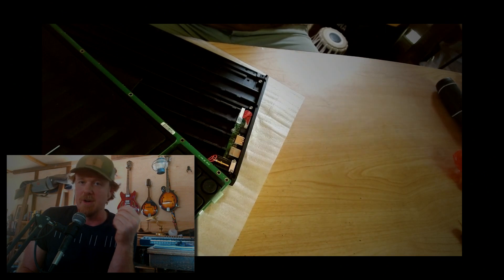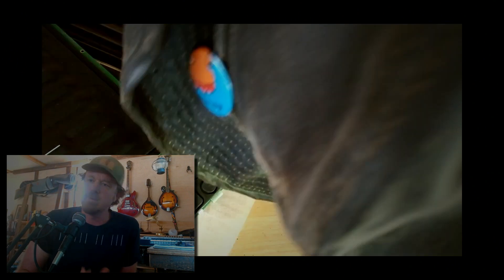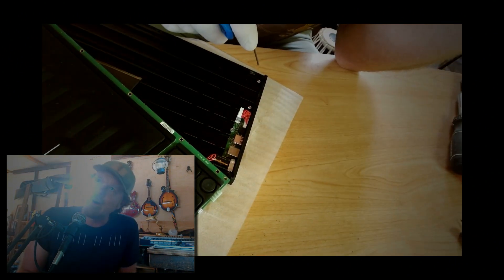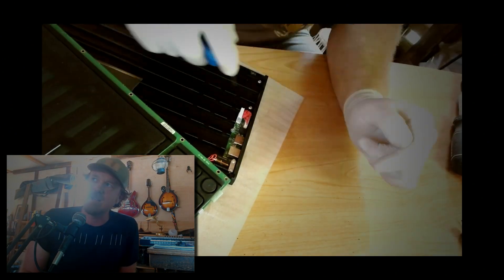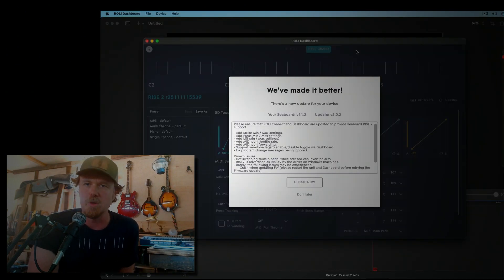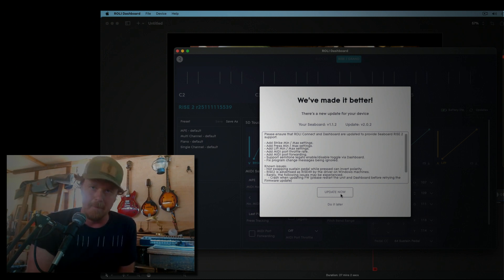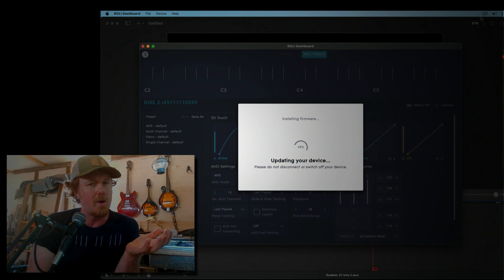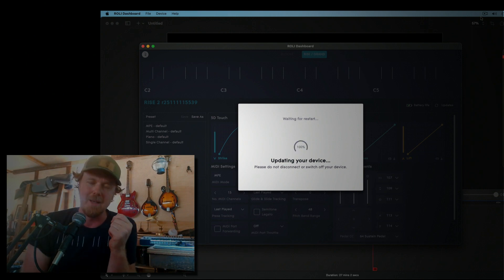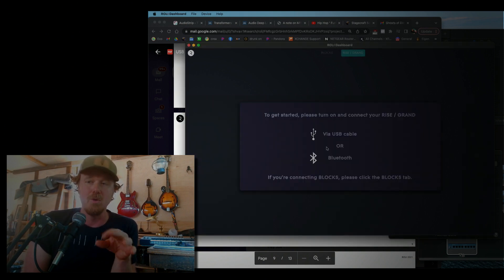I ordered that part, they sent it. You need some very small screwdrivers and a little bit of skill with circuit boards to switch it out, but it's not that hard. I switched it out, and I think I may have done a factory reset in there too. After I swapped it out, it was working. Case closed, right? Then a little while later as I'm playing, something pops up on the dashboard saying we've made it better, update to the newest firmware. I clicked update, and it was bricked again. So it sounds like maybe it's not hardware — maybe it's a firmware problem, as it is. So if you are having this problem, don't bother replacing the board until you've updated the firmware.